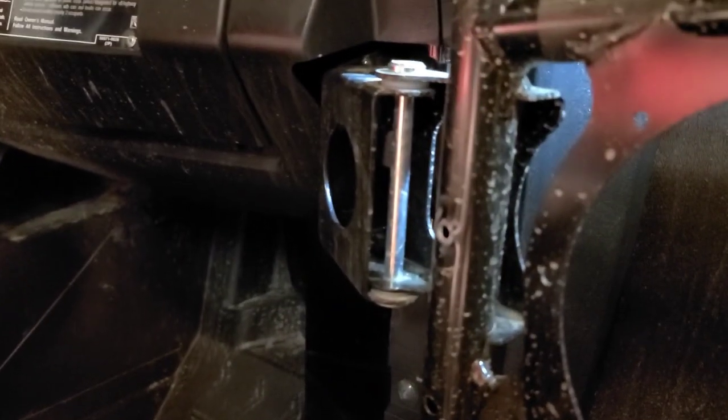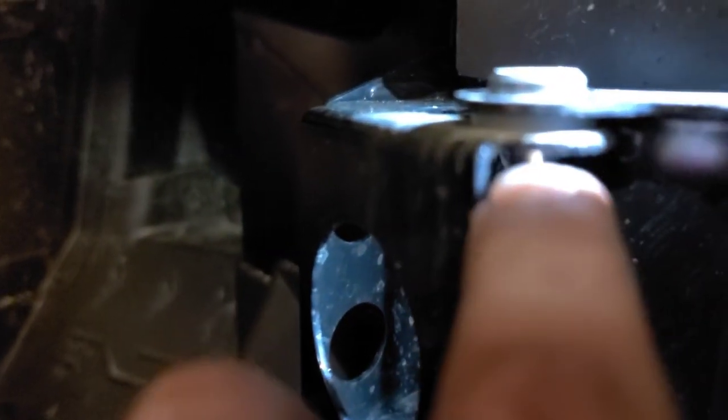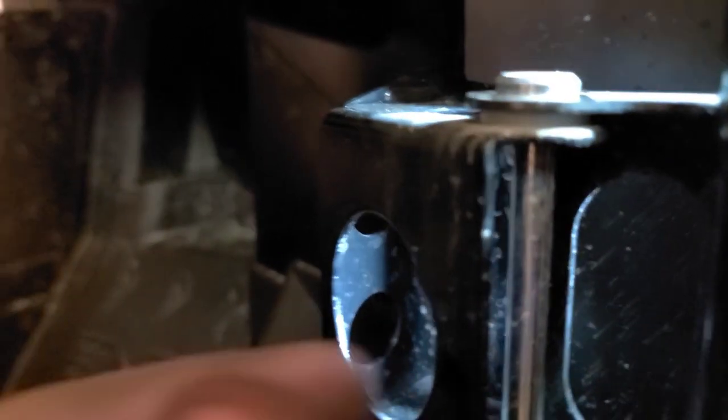All the door skins are off. These are actually your hinges, top and bottom, and the bushing sits right there — that's the plastic bushing that wears out. We're gonna remove those and put the brass ones in to make it good and tight. Getting these off is kind of a pain.